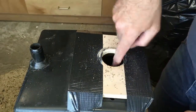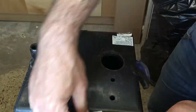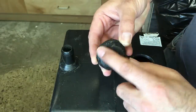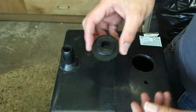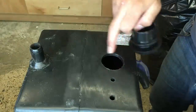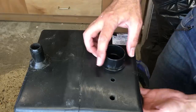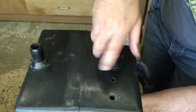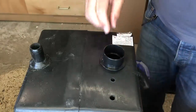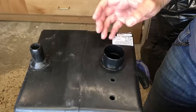Really nice and easy - no pressure, just let the cutter do the work. There's the piece we've cut out. I've got rid of all of that welded plastic and that inner part completely, so now this is just a nice flat surface on the inside and outside. Just a little light sandpaper to take those one or two little burrs off. Put the back nut on from the other side with a little bead of silicone, and there we go - we've got a solvent weld inch and a half connection.